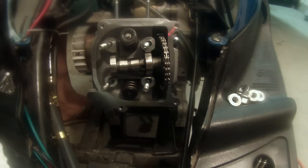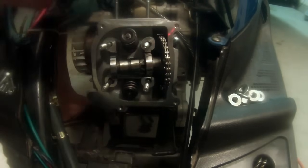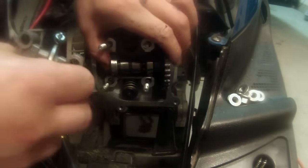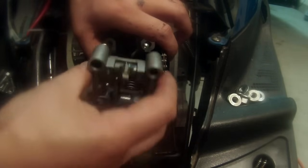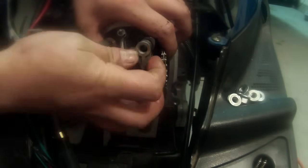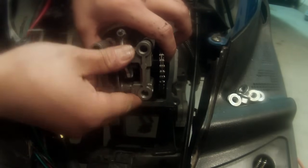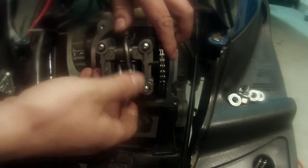At this point, we can put our spacers in. So we have a spacer and a spacer. And we can put our rocker assembly on. We're going to make sure this guy's lined up nice. There's not notches or anything that hold it on that one, but there is on this rocker assembly. So when we put that on, it should give us not much of a choice. You have to kind of hold these rockers up so it doesn't bind it all up. There we go.